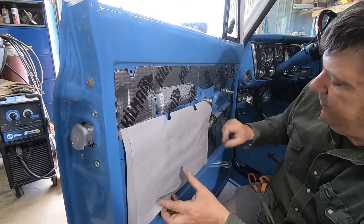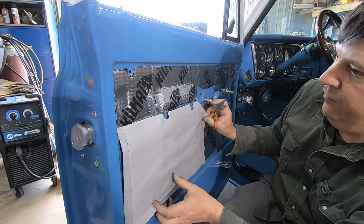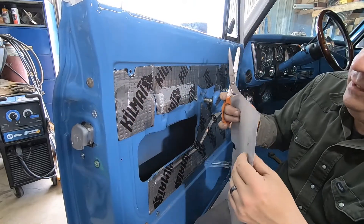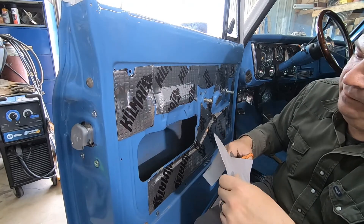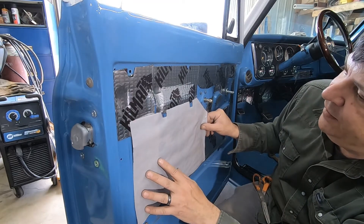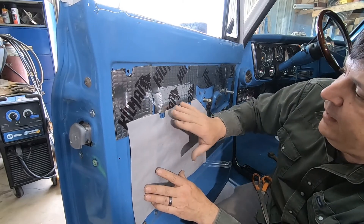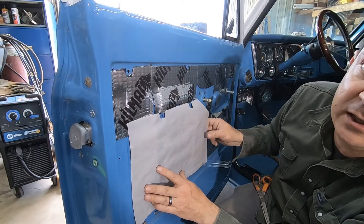Make sure I know where I'm going first — right here — I'm going to nip that. If I move back there I'm going to have to nip the back of it off a bit too. Everything's glued together so we're going to be in good shape. Door panel fits out to those edges, so I can spray adhesive this in here and it'll be nice. That should help seal the dust and everything from coming into your doors.